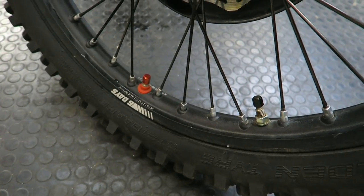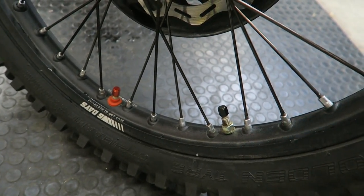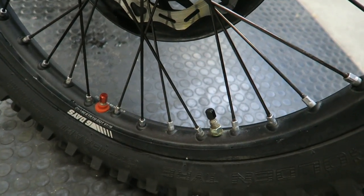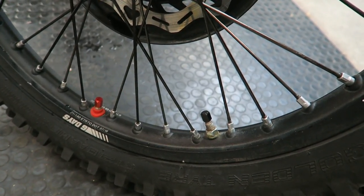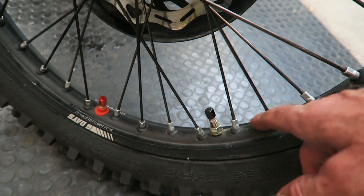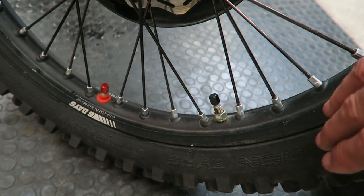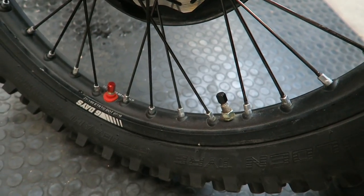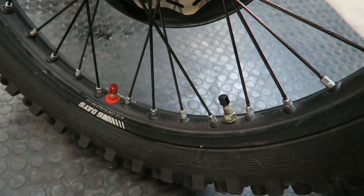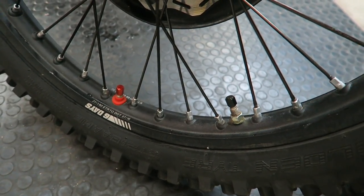If you have an older bike you might find that some of those spoke nipples are seized up. Before doing the spoke torque setting you should go around the whole wheel and make sure none of the spokes are seized. If a spoke is seized it's not going to give an accurate torque setting, so make sure they will turn freely. I'd recommend doing spoke torque checks as part of your regular bike maintenance — maybe when you change the oil or something like that.